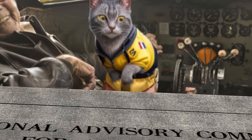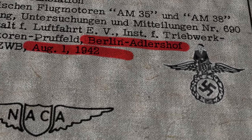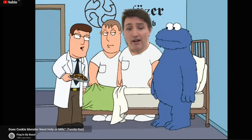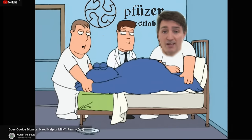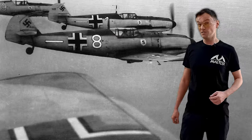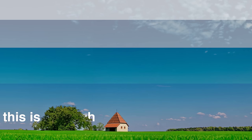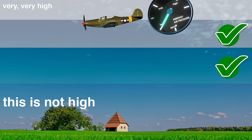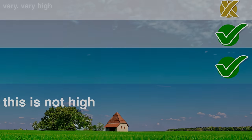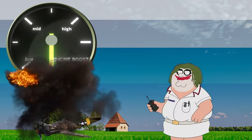It's very likely that JP Booty read the same research paper. Back then, fighter planes were almost always supercharged by a centrifugal compressor, and the engine-supercharger combinations were optimized for a flight height of a couple of thousand feet. As the air gets thinner the higher the plane goes, you have to pump it into the engine to make any power at all. But since these superchargers are directly coupled to the engine speed, this created an interesting issue: when the ambient air gets thicker than what the engine was designed for, the supercharger will overboost and kill the engine.